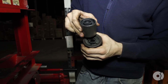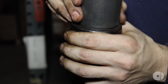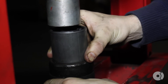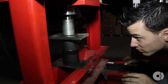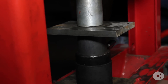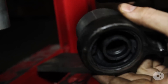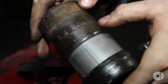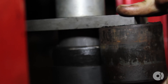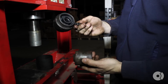To push the new bushing in and finish pushing out the old bushing, I'm going to make sure that the alignment tabs are correct. I'm going to follow the line of the new bushing and set the bushing in the press. With the new bushing halfway pushed in, the alignment tabs are still good to go. I want to make sure I'm only pushing the bushing in as far as the previous bushing was, so you can see how much distance we still have to cover with the press. We've got the new bushing pushed into the lollipop, so now we're going to go reinstall it onto the control arm.